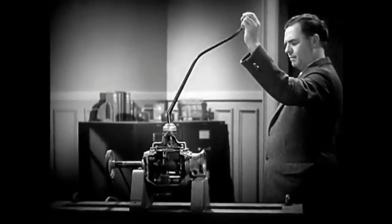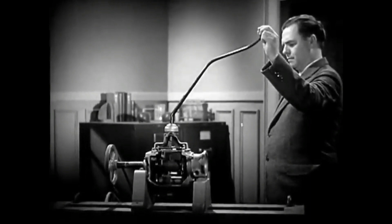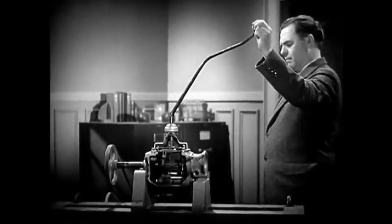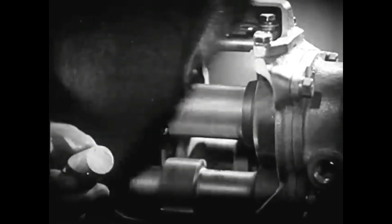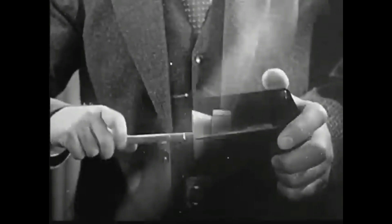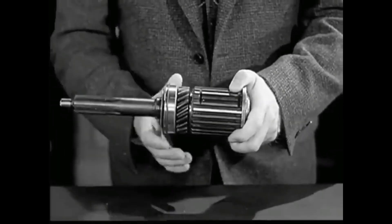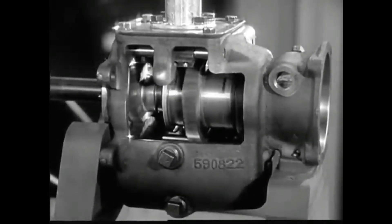But with all these spinning levers in the transmission came noise and wear. Experts could shift gears quietly by careful timing of the gear shift and engine speeds, but most of us made plenty of noise — until new engineering developments made possible a long series of improvements. When we shifted gears we got a clash because the gears were not running at the same speed — in other words, not synchronized. So engineers set to work to develop a synchronizer. The synchronizer works like a cork twisted into the top of a bottle — the cork will turn until it is so tight that the bottle turns with it. Synchromesh works the same way: when we shift into second or high, the synchronizer brings the gears to the same speed before they come together. The drums won't let the gears shift unless they are turning at the same speed, so when the gears come together there is no clash and the shift is made quietly and easily.